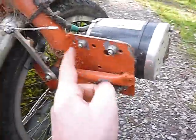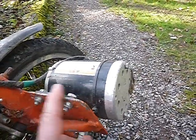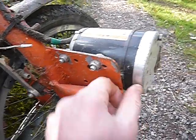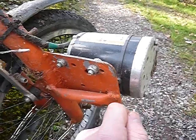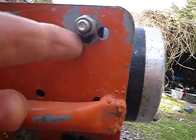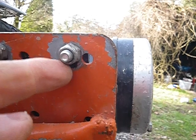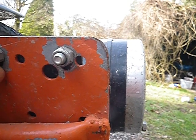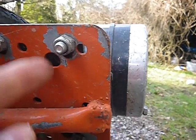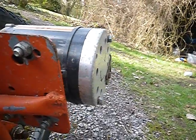You need to make a mounting bracket here, a plate coming out on the side, just made out of some 3-4mm steel plate. I put a brace in the back because it's a little bit bendy forwards and backwards, and that gets rid of that. When you're doing the holes to mount your motor, once you've drilled them get a file and file them so they're elongated up and down — then you can slide the motor up and down to tension the chain.